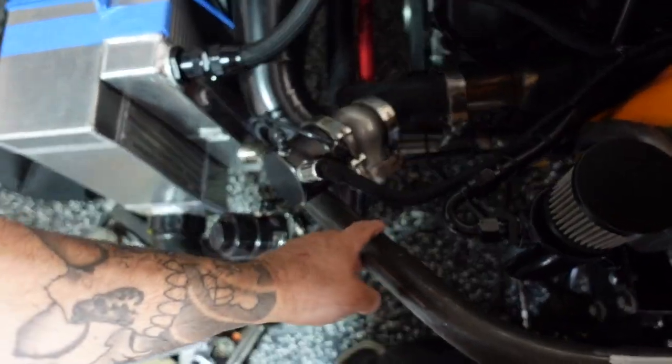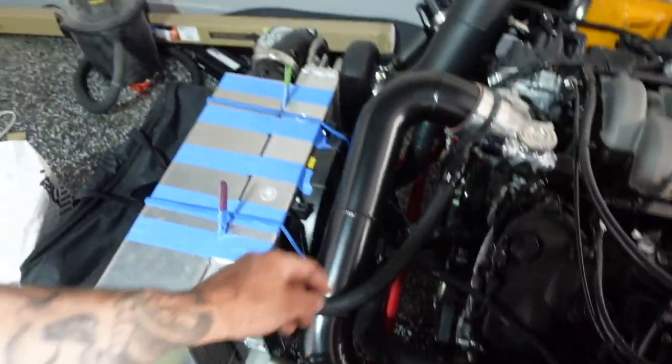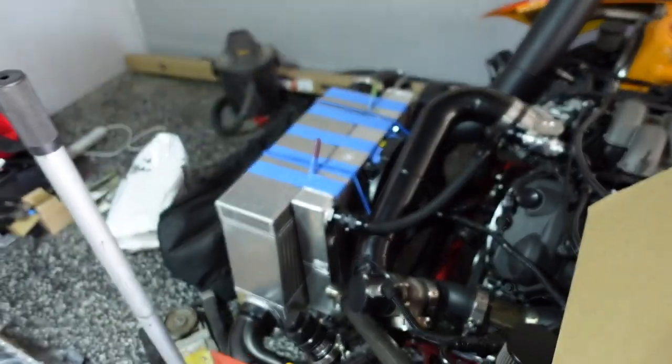The car's going back to Joe's today. We're gonna put the upper radiator support on, get that mounted, some tabs for the headlights, tabs for the bumper. And dump tubes — we need dump tubes. I have the piping. Joe's just gonna pretty much 90 out of there and go straight down, same thing on the other side.